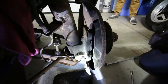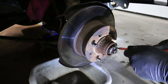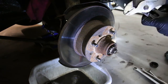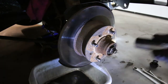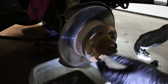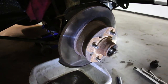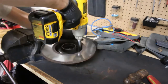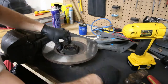Now that we've got the caliper off, we can take the dust cap off for the axle nut. There's a cotter pin that's got to come off, and there's also a little piece in there that covers the axle nut itself. We'll take that little piece off, then take off the axle nut. Now this shouldn't be really tight — the torque spec isn't too crazy, so it should be pretty loose. You're going to take off a washer and then the outer bearing portion. Once we get the hub and rotor off, as I mentioned, it's a two-piece system, so there are four bolts that will allow you to separate the rotor and the hub.